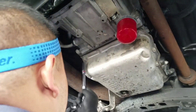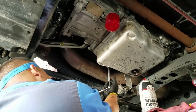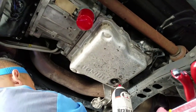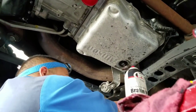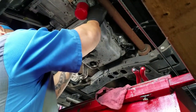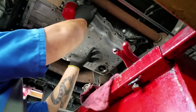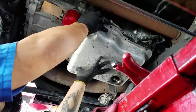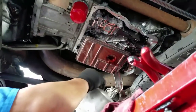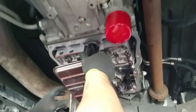Go ahead and loosen up all the other bolts. Chris is down here at Express Lube and Auto Repair — Jeff's here, Chris is here, and he's nailing all these little 13 millimeter bolts. We're going to drop the pan down. Getting our last bolt. And there she goes — beautiful. We're going to drop that down. Go ahead and pull her down, Chris.